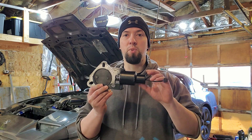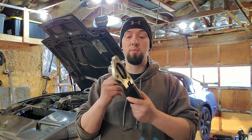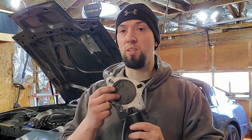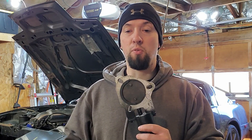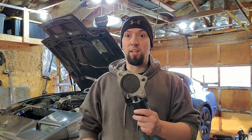With these QuickTime cutouts, they're expensive, they are made nice, the quality is good. The problem with them is these valves cannot take any kind of two-step or backfire. The first time I bent it was before I had two-step on the 300ZX — it was a backfire for whatever reason. It bent this valve like a taco.